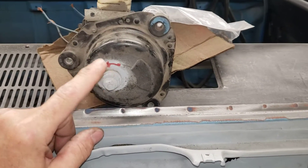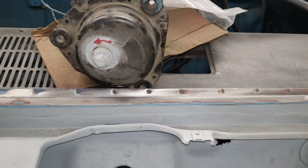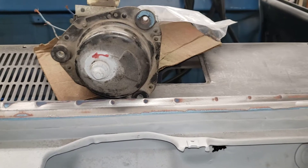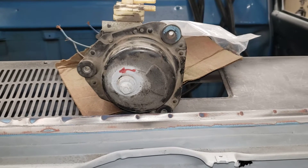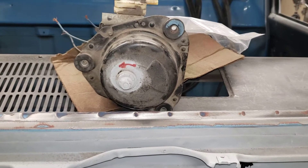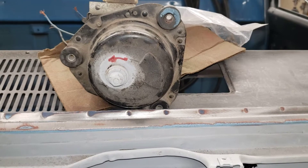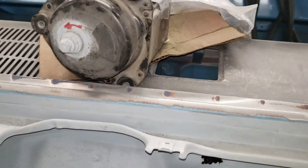The stock motors turn counterclockwise. We thought we'd really like to upgrade because we're going to be able to go comfortably down the road at 70 or 80 miles an hour. The problem we discovered was that the newer style motor on the '06 actually rotates in a clockwise direction, so it's not as easy as just mounting the motor right in and hooking everything up.